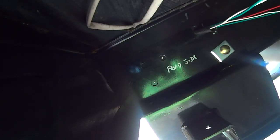After drilling the first hole in the frame and temporarily attaching the bracket, I used a 9/16 inch drill bit for each of the other holes, which simply marked the hole location in the frame. That way, when I remove the bracket, I will have my own self-centered tapped holes.